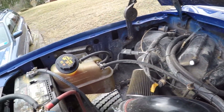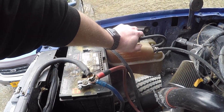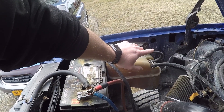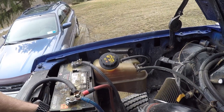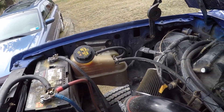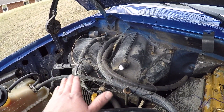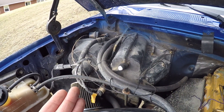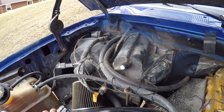The other issue with the system is I put my reservoir down here. I thought it looked neater being out of the way, but it is too low. It's like a never-ending cycle — you add more and it just pushes it out. The level it finds is just above the fins, so the heater hoses are just above the reservoir. Chances are the heater core has an air pocket in it and it's not getting any hot coolant flowing through it.